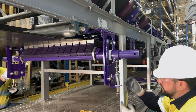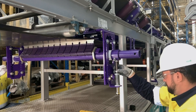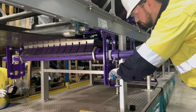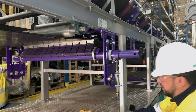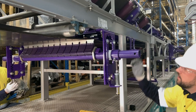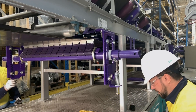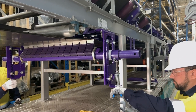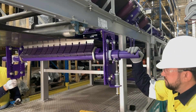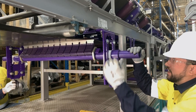Once we've achieved the three and three-quarters of an inch spring length, we can lock our jam nut, and then we're going to want to adjust our sleeve so that we have about an inch and a half exposed below the bushing — that's going to give us free play. Then we're going to lock it into place. The last step with any spring tension secondary cleaner is to make sure that it bounces freely for mechanical splice relief.